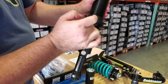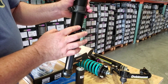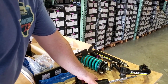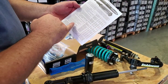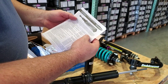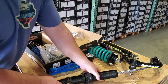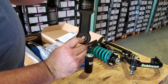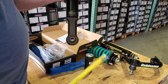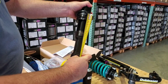So how do you set the coil seat height? I'm just going to do a quick demonstration. We'll leave the bottom one loose and the top one approximately where we want it. We're going to take our tape measure. The standard vehicles are all listed on here — Toyota Land Cruiser Prado 150 and FJ Cruiser — standard coil seat height is 213mm. That measurement is from the center of the lower mount to the bottom lip of the coil seat. The center of the lower mount is easy to ballpark since it's only about one centimeter thick.